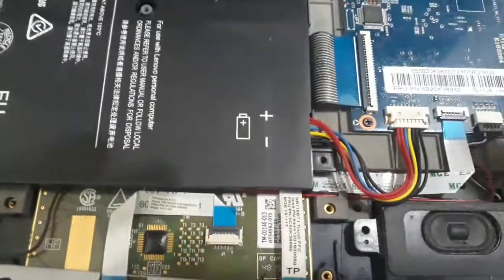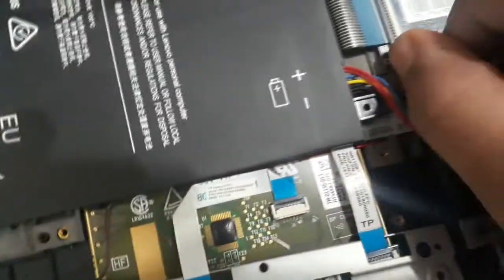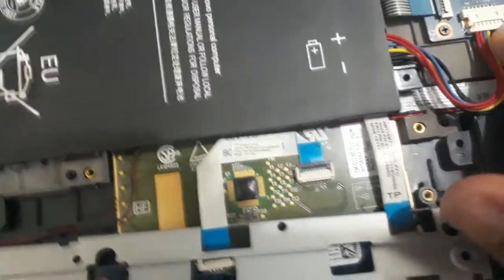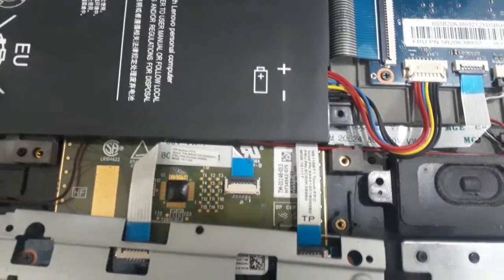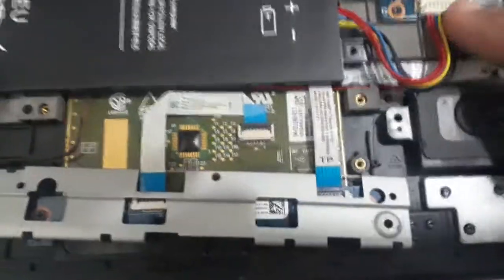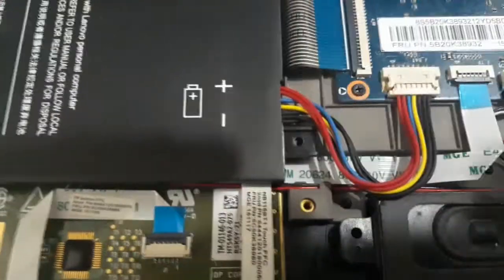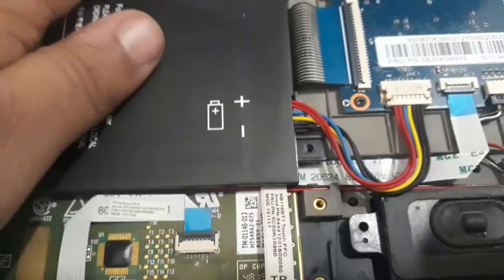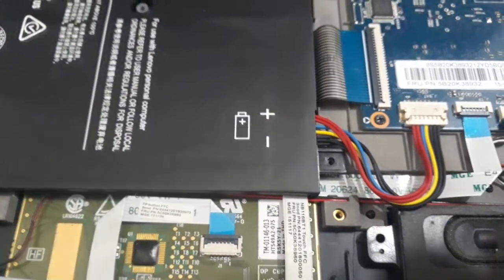Okay, now I've got it. I was not able to switch it on because I had actually connected the connector the wrong way — I had inserted it from the other side. For some reason it never complained; I didn't face any difficulty putting the connector in the wrong way. That was the reason why I was not able to get the laptop on. Once I flipped it, this is the right way to do it. If you don't put the connectors in the correct direction, you won't be able to get the new battery charged and you won't be able to get the laptop on.